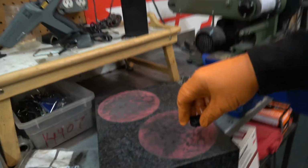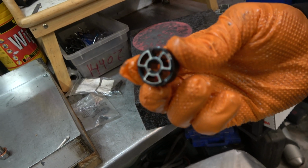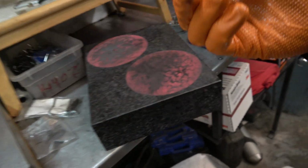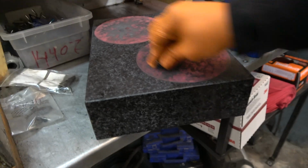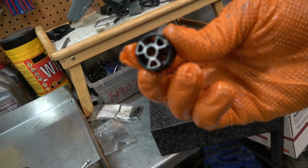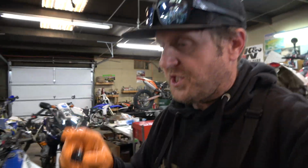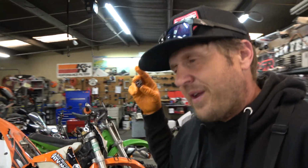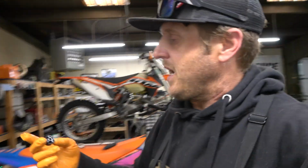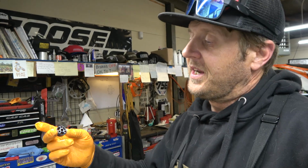But what you want to do is take it onto this machined surface. I'm going to go like that. You see, there we go. So you put that shiny edge on there. Do that on both sides. You can see what that does is it ensures that we get a really good seal with our shims on this. These are really pretty flat when you look at them. If you take them and measure them, they're not perfect, but they're really pretty good stock these days. They used to not be so good, but this makes sure 100% you're going to get a really good seal.